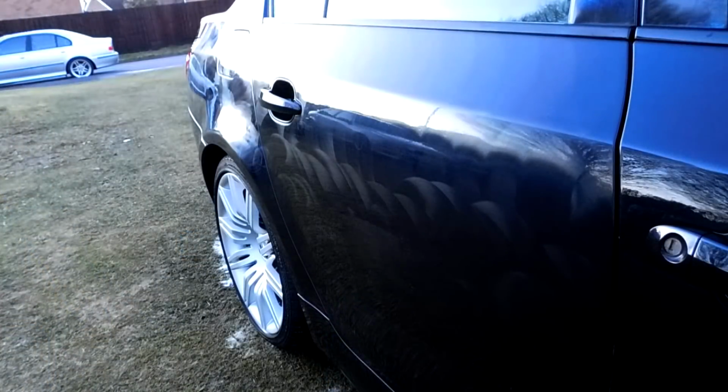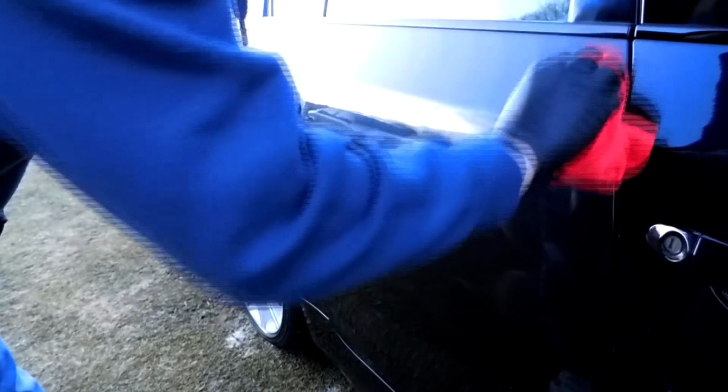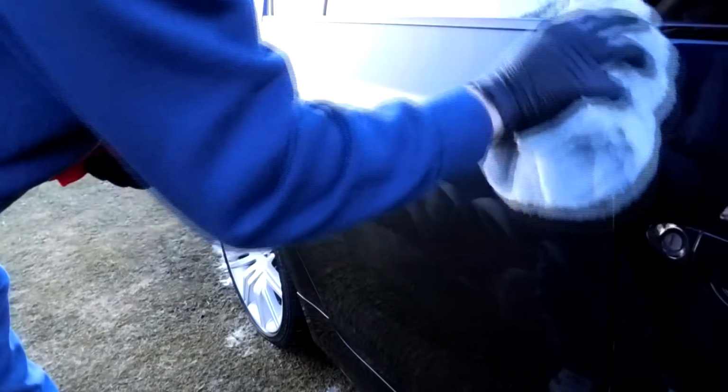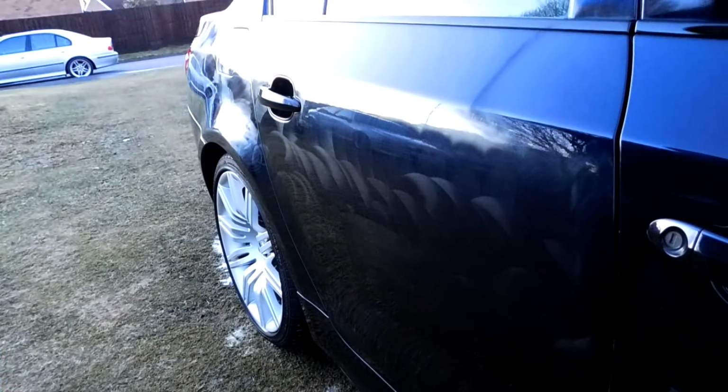Now, on the day of use, the temperature was dropping, and it was getting colder as we went, and it was quite late in the day by the time I got around to waxing. So it got a good patient cure. I'd estimate maybe around about 3 or 4 degrees. Ended up giving it 15, maybe 18 minutes just to be certain of the cure.